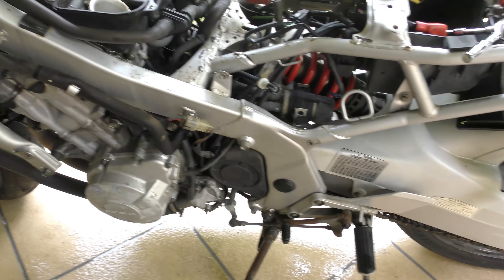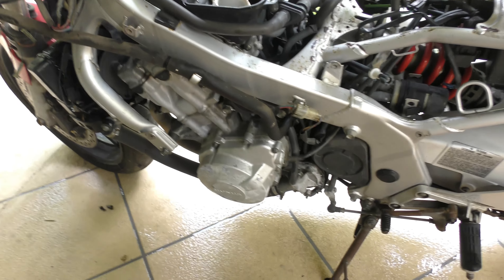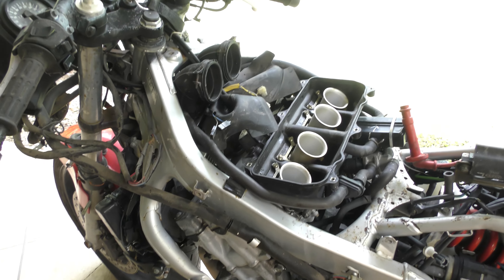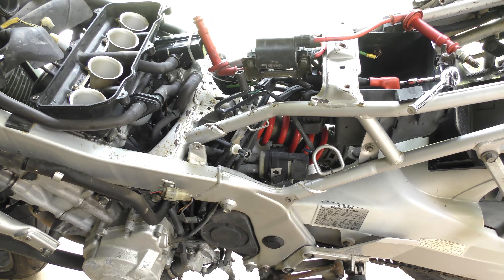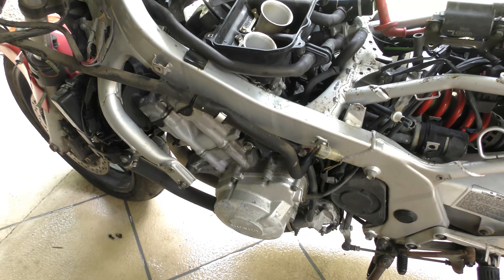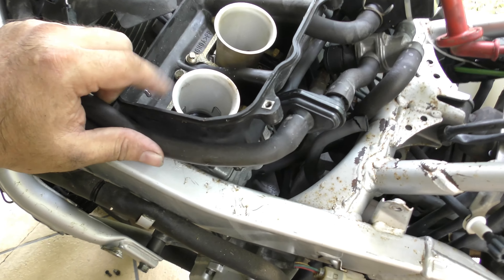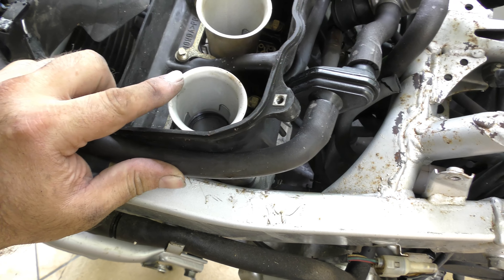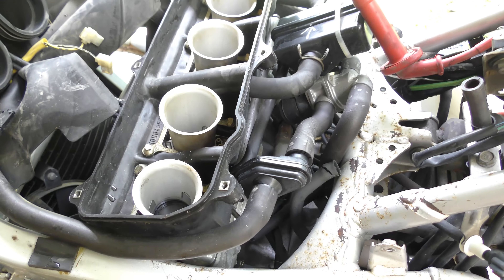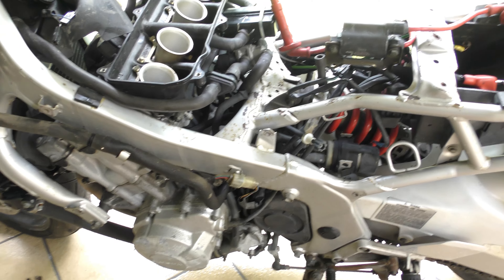We'll do the CDI — I've also got a fuel cut relay which I didn't mention before — and we'll do the carbs. Basically give the bike the full rundown. The fairings are over there ready to sell. Next video I'll be installing all the bits when they arrive. One more thing: I made a rookie mistake assuming the venturis were capped off separately, which they're not, and I've got some water down the carburetors. I quickly put some two-stroke pre-mix down there, and I'm going to pull those plugs and give it a crank over just to make sure I've got nice compression. That'll be it for today.